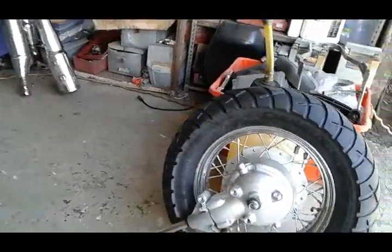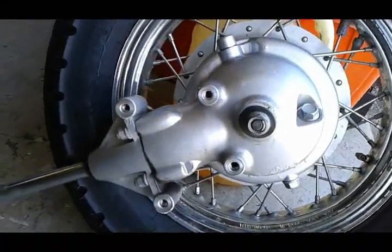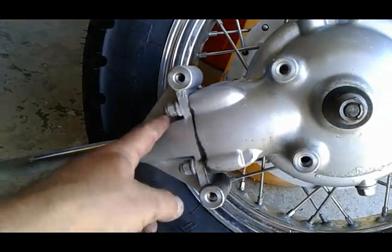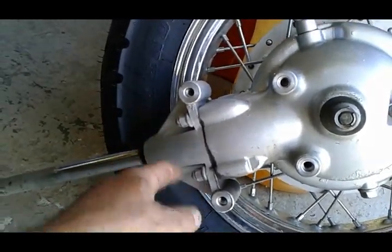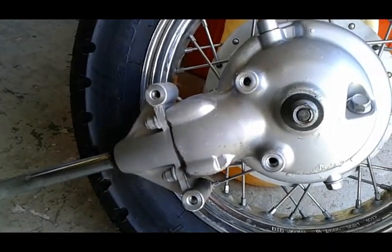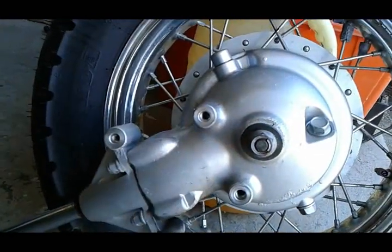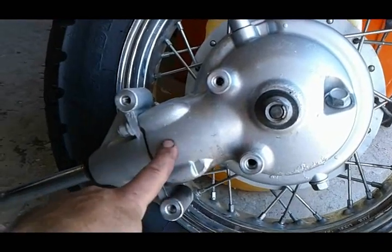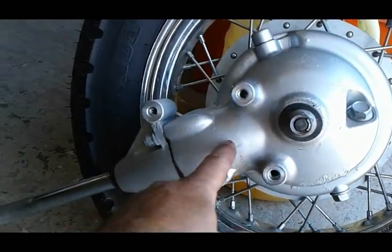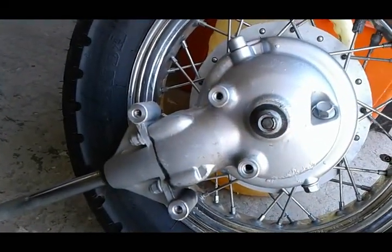The reason I'm doing this video is I want to show you what has to be lubed, because this is like the Achilles heel on these bikes. There is a spline and a coupler underneath this cover — you just take these four bolts out, it comes apart, and you've got to lube that up every time you do a tire change. If you don't, the splines can strip, and if they strip inside this you're looking at about a thousand dollars, because they don't sell the parts separately. They do sell the coupler, but they don't sell the spline coming out of the gearbox — you've got to buy the whole thing.